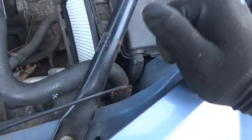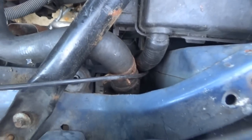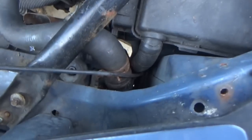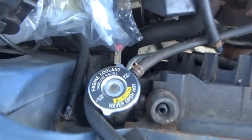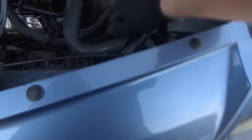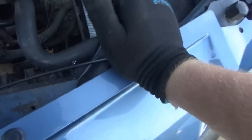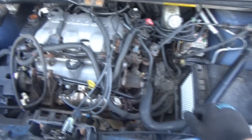What we were doing is when the car was getting warm, the steam was coming up from down here somewhere - once the thermostat opened up and it was passing through, we were getting steam. And shortly after, it started getting it over here too. I believe the sides of the radiator are plastic and I'm assuming there's probably a crack. That's probably what was wrong with this car when I bought it - and why it overheated on the previous owners - because it probably had a bad radiator. Either they neglected to tell me that, or they didn't really notice it until it finally overheated on them.